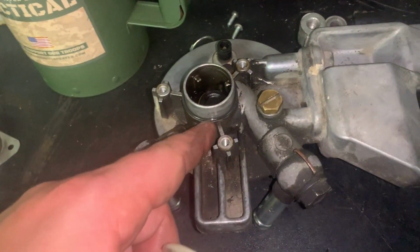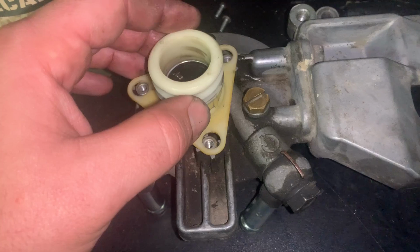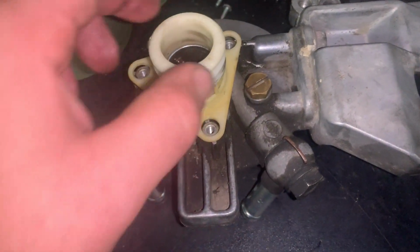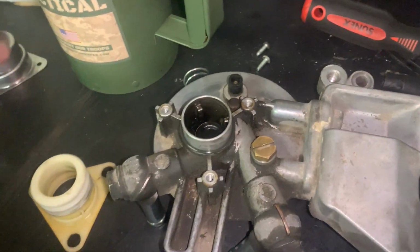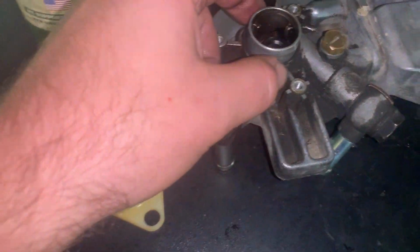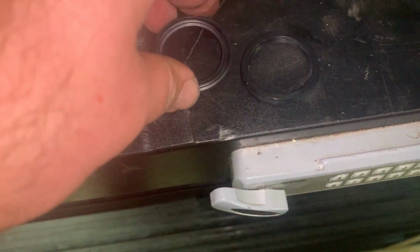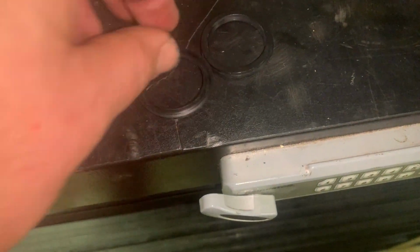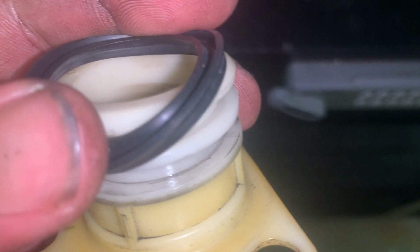And this seal kind of seats it right in there. And then you push this on, and once it's pushed down, it screws itself in. This kind of goes on like this. But before you do that, this side's pretty much done. But we need to use our 2 main screw seals right here. And remember, on these 2, the open side faces the top. On the top one, the open side's going to go like that.